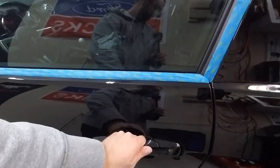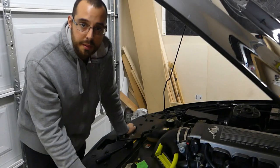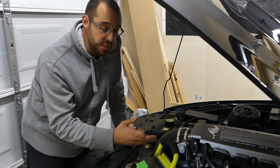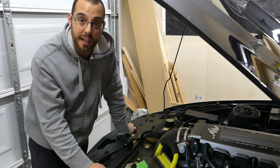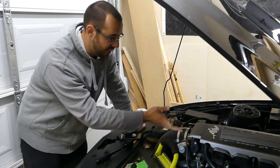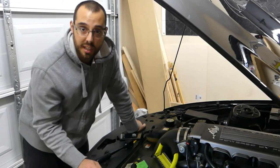Now over time you are going to typically need to replace these. But I found years ago — I don't even think it was on a Ford forum — I came across a way that you can actually clean them and it maybe costs you $30. I want to show you how to do that today. One of the best ways to prevent misfires on a Ford engine is to do preventative maintenance, like changing your spark plugs before the recommended interval, which is something Ford ended up doing on the three-valve engines — they changed the interval to 60,000 miles because of the breakage issue. The coil-on plugs on a rear-wheel drive engine are so simple to change because they're staring you right in the face. I'm going to show you how to clean it. It basically costs about $30 and about a half hour of your time.